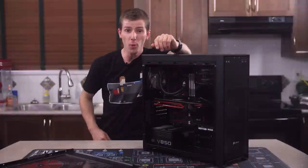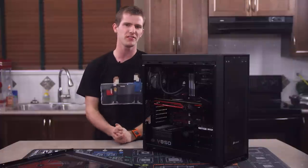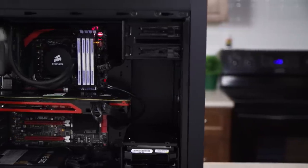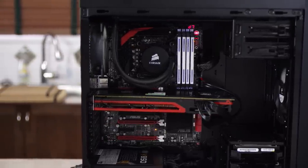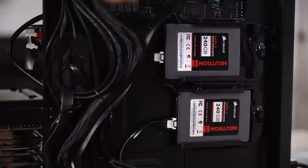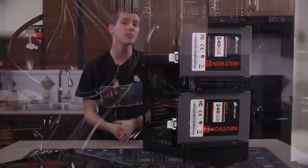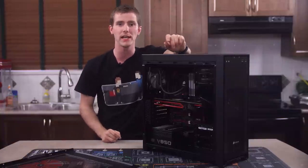Now that the case is open, the layout will look pretty familiar to anyone who has seen its little MATX brother, the 350D. By comparison, the 450D accepts a full size ATX motherboard, and Corsair has basically just added a three-and-a-half-inch slash two-and-a-half-inch drive bay sled to utilize the extra height, and moved the super handy spring-loaded SSD mounts to the back of the motherboard tray - a great move since it frees up space in the front for either a 240 or 280mm radiator.